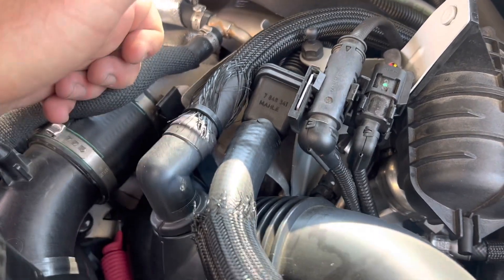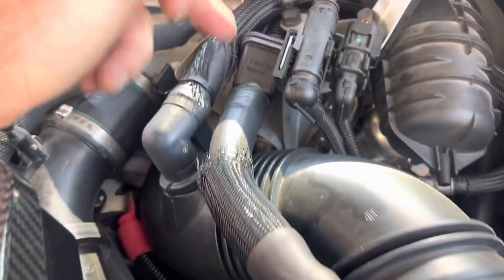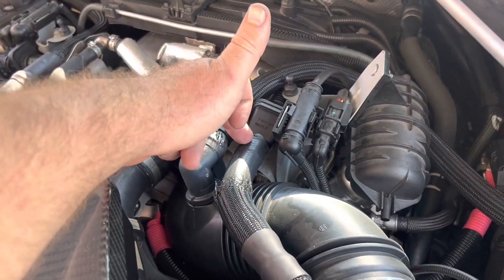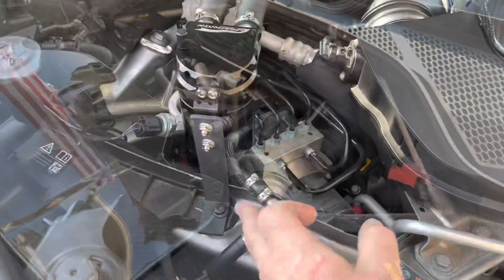The factory vents have a plastic fitting on the end. All you have to do is slide it off — you'll see a clip on it, remove the clip and it slides off. Then the 3/4" hose slides over this fitting. It's going to be very tight, and probably the worst part of the whole install is sliding the 3/4" hose over it.